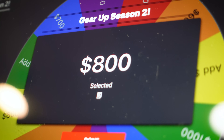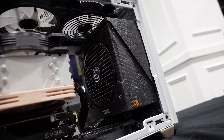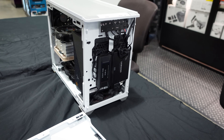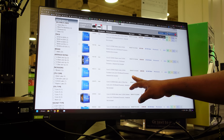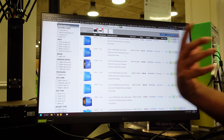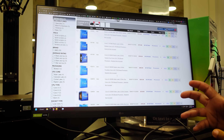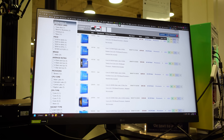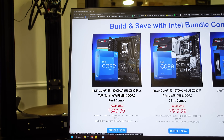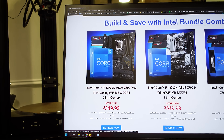Knowing that, what do you want to recycle from the old rig? Definitely do a processor update, so we're looking at a platform all around and see where we can squeeze a graphics card in if possible. 800 is a pretty healthy budget. One option: the 13600K for $300 makes a lot of sense — pair that with an open box motherboard and you'd be around $400, then add a graphics card with the extra $400, putting you right at $800. That's $349 — a way better option, and you get DDR5 with that. After much deliberation, I think we've honed in on something.